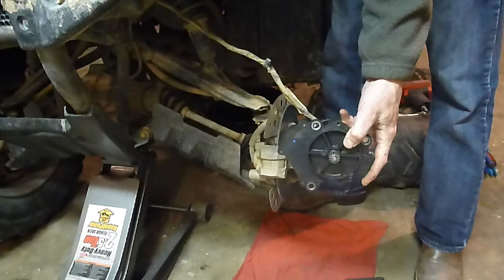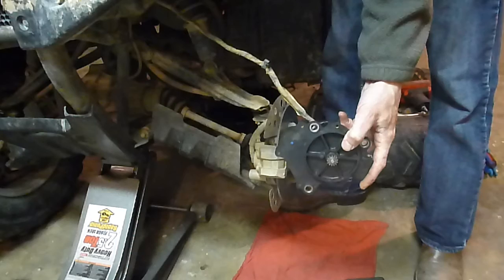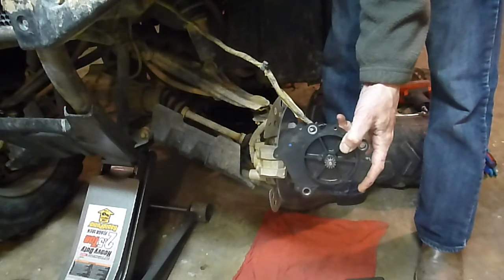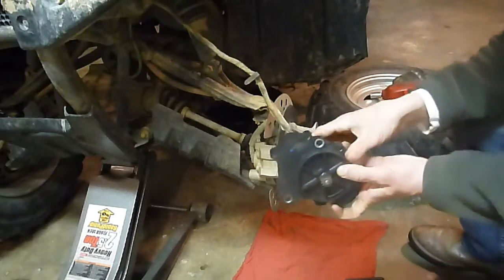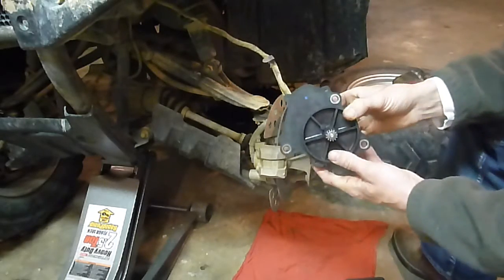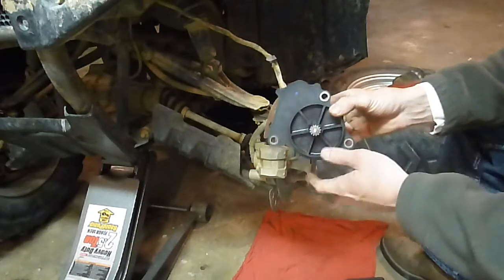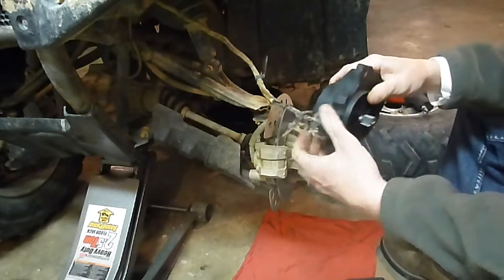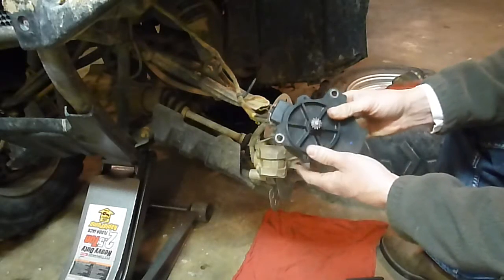So I'm going to hit four wheel drive, diff lock, back to four wheel drive, back to two wheel drive. That lets you know it's good to go. You can keep your button in two wheel drive. Make sure your slide gear is all the way to the left. You can unplug all this now, bolt it back together and install it. Fill it with gear oil and you're back on the trails.